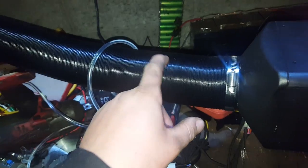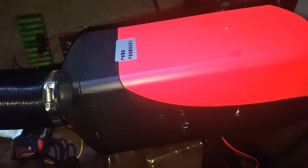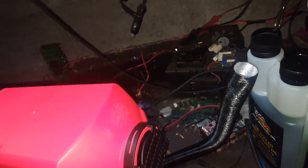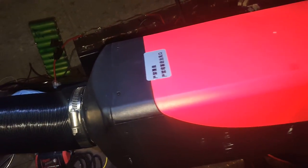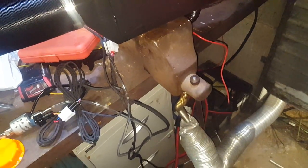There's your intake fan — there's a duct that goes on there as part of the kit, same as this one. There's also an air intake filter for that, and there's your intake outlet tube. For a little bit it just heats up the glow plug, lets a bit of heat build up. It clears the combustion chamber — it's actually like a venturi, sucking a bit of air through at the moment. The voltage just dipped a little bit harder, heating up the glow plug. Once it gets to a certain temperature it senses, and you hear it start burning.